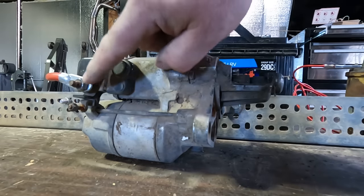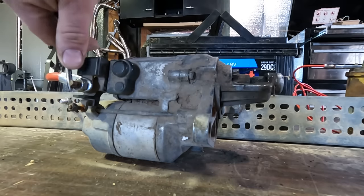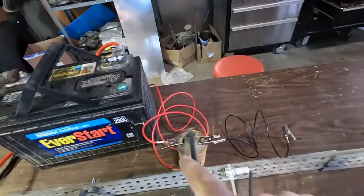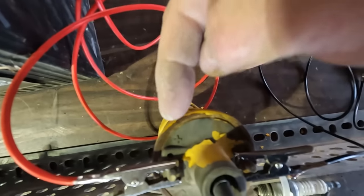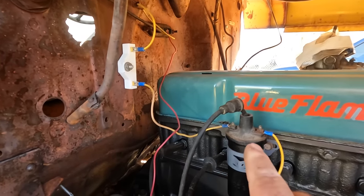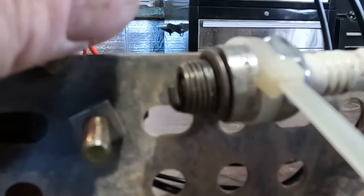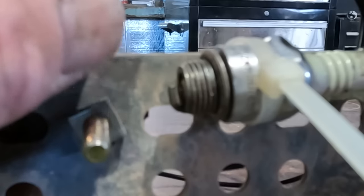One critical thing is the starter is normally bolted to an engine, and that engine needs to be grounded to the chassis. All we need to do is take power where it's coming into the main terminal on the starter and trigger the electric solenoid. You take something conductive like a screwdriver and that cranks your engine over. In order to get your engine running, you're going to need this circuit. Here's a basic coil system with two terminals — a positive and a negative. It doesn't spark until you remove that wire — when I take the wire off, you get a spark. In theory, that will fire the engine, but it's going to be a bit of a distraction while driving.